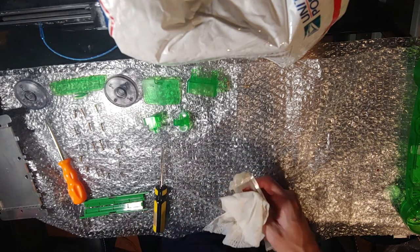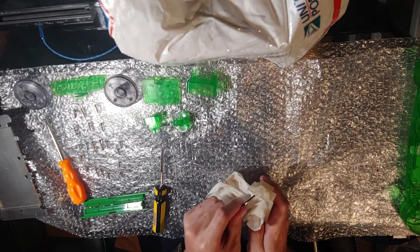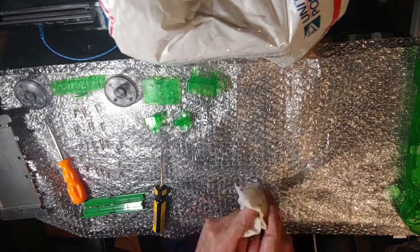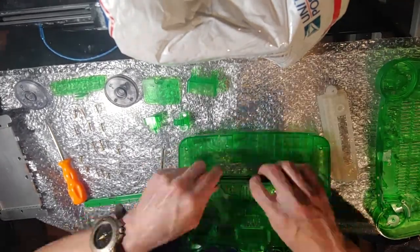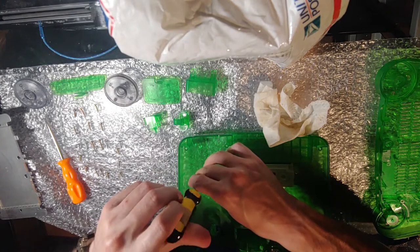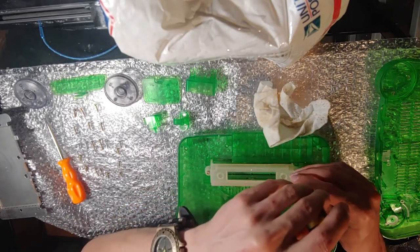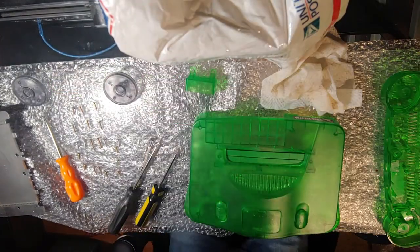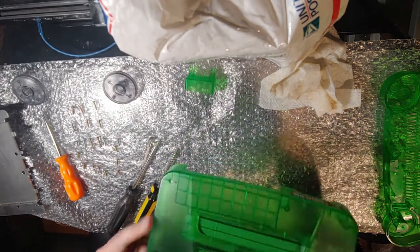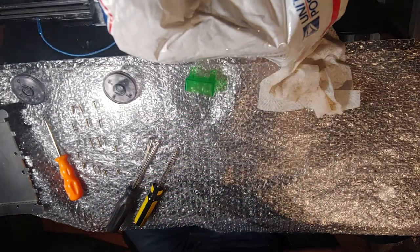A trick to get into the corners: I like to get a tiny little flat-head screwdriver and just rub it back and forth. Make sure you have enough padding that you don't scratch anything accidentally. And for plastic screws, I like to go back until it catches and then thread it in — that way you don't risk stripping it out. I've got everything cleaned up as nice as it possibly will go, and I'm going to put it all back together. It looks really nice.